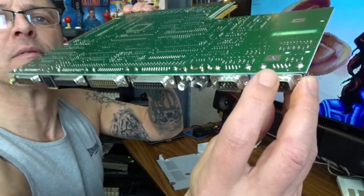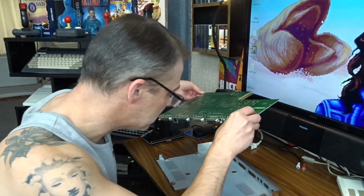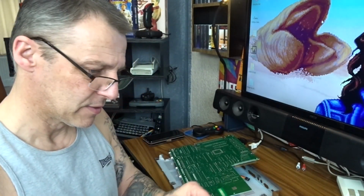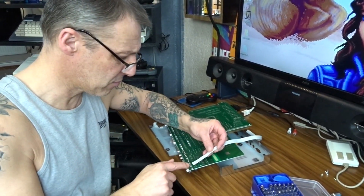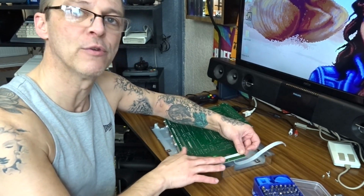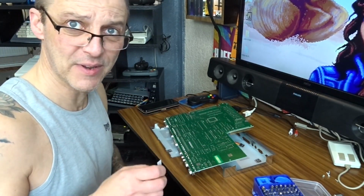That's the other side. The 9-pin. We need to solder a ribbon onto there, going across and back out the other end of the board. A long strip of ribbon, counted 9 off with a strand, so just pull it off. In theory, this will go from there. Can you see? No. In theory, solder it up to these pins. It'll go down, around, and back out the other end, so it'll be nice and flush, so it's not raising the board off of this. The only problem is I've got one stand-off there that I've got to watch for. So I need to bring it over a bit. But other than that, that's the idea.